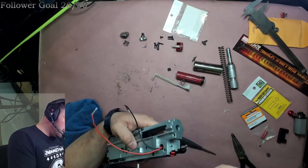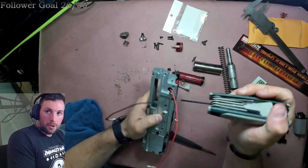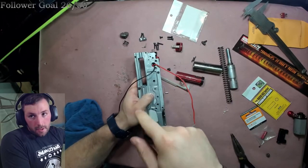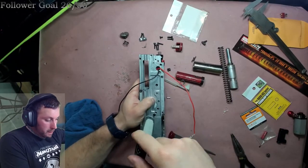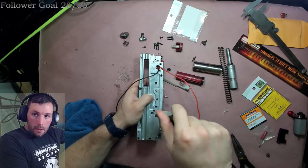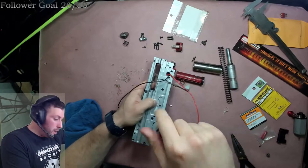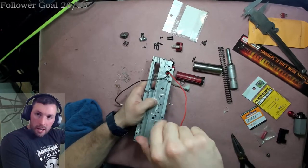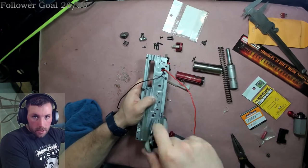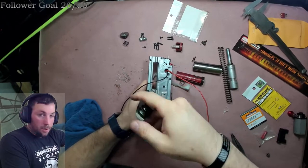You want to be very vigilant of making sure that these wires don't get pinched on the parts where there is no clearance on the shell. Because if you pinch your wires badly enough, you're going to have to put a new wire in. Sometimes you can get away with just putting the shield back on, or you can shrink tube it. But other times you're going to have to completely replace the wire, which is pretty easy on these because it's mostly quick disconnects. But any work that you didn't intend on doing is going to take time away from the stuff that you wanted to do.